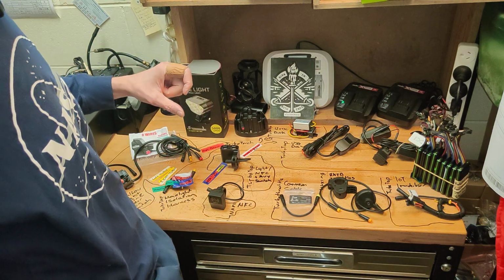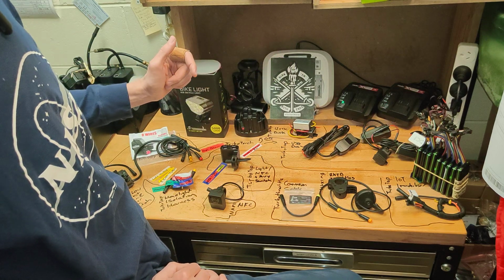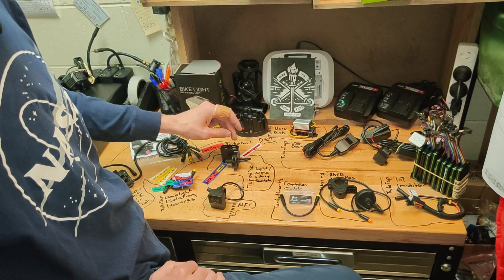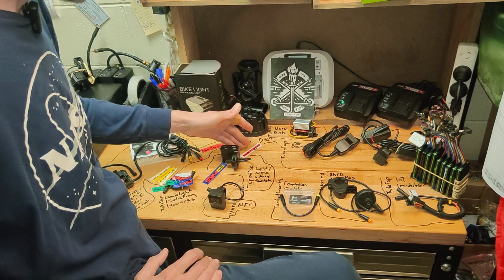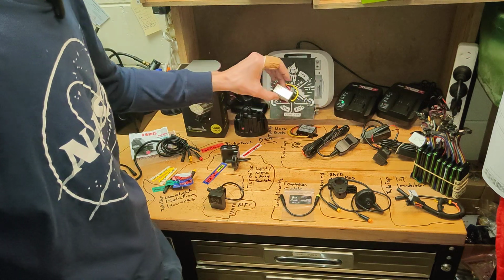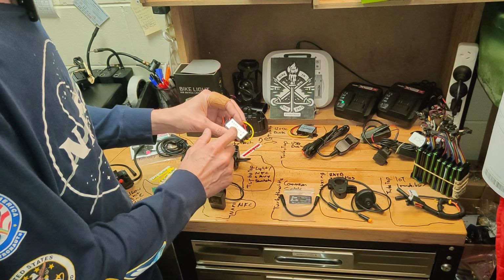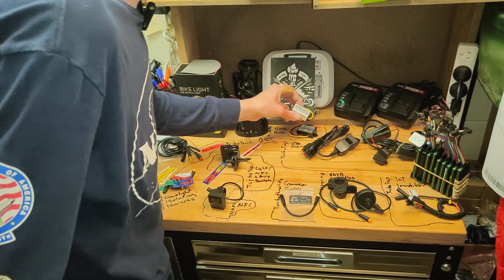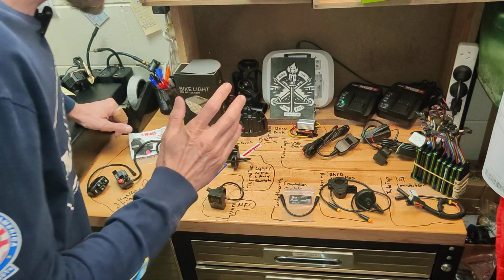So when the scooter's powered on, and this switch is turned on, you've got power output. As opposed to always on, where there's always power going to the switch, and when you turn the switch on, it comes on. The scooter doesn't need to be turned on for that to flow. The problem with always on is that it's going to draw down a little bit on your battery reserve, because these buck converters have a very small standby current running through. Not much though, not much.